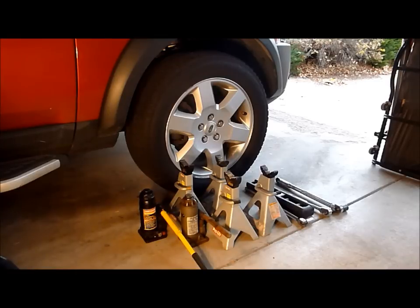You're going to need a couple of jacks, a really good metric socket set, a good breaker bar, a good torque wrench, some penetrating fluid, some good work gloves, a hammer — stuff like that. These are all things we're going to need to get into this suspension safely. First thing we're going to do is jack this vehicle up, rest it on the jack stands safely, get it really secure, then remove the wheel and start going at the wheel well, looking at the suspension components we'll have to disassemble to get these new air struts in place.